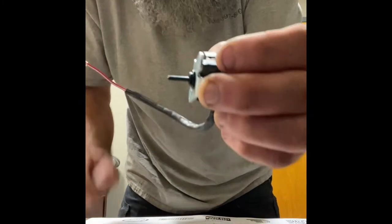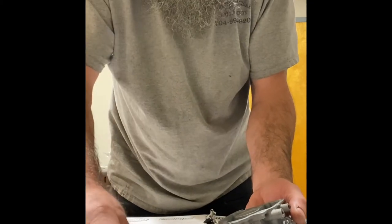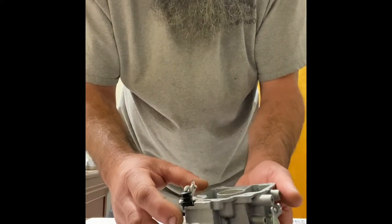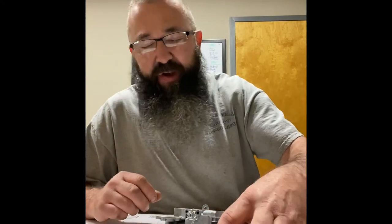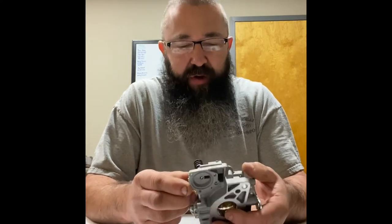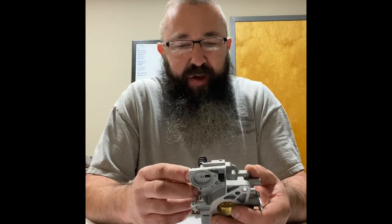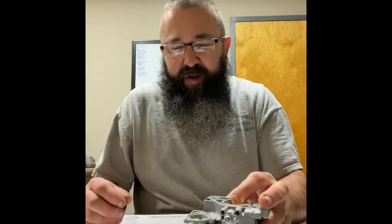Other modifications — we covered the anti-backfire valve, just snip that off and send it. We're going to get into the pump itself. Then I'm going to show you what we've got to do to extend the float bowl vents a little bit higher so that you don't get fuel sloshing and stalling your engine out, flooding it out. Modifications are done. I don't have a great way to explain how these check valves work — the best thing to do is search on YouTube or the internet for how check valves work and how fuel pumps work. They all have the same basic design.